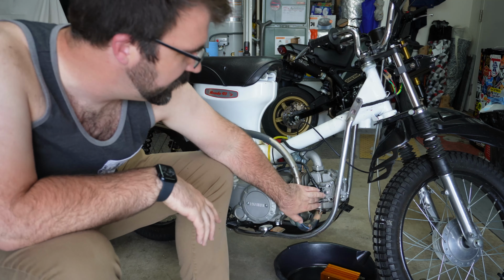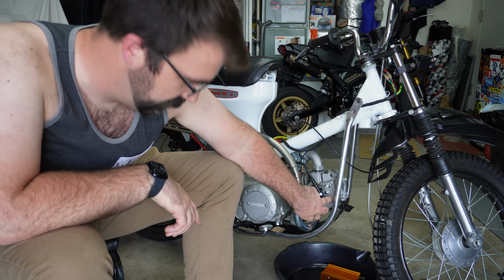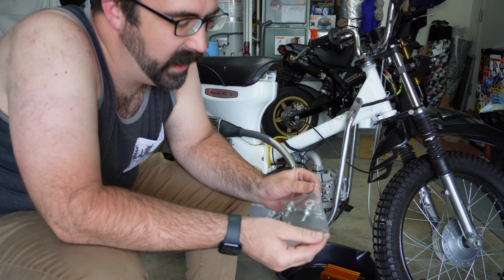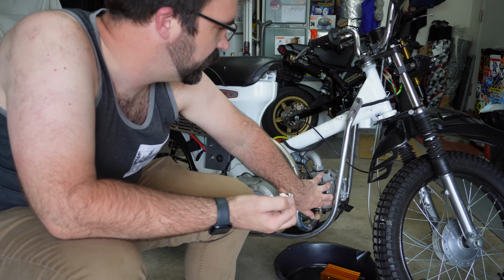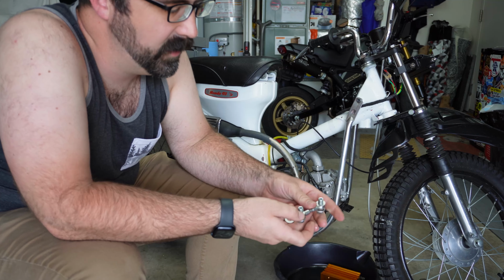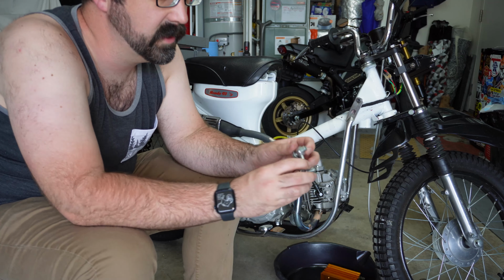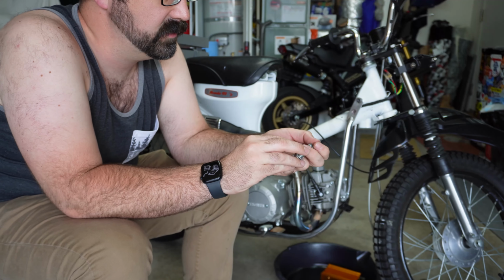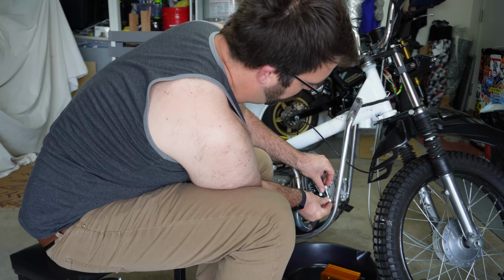One of the other nice things that we're dealing with now is it came with the oil cooler head plate already on there. A lot of the YX motors you can put aftermarket coolers on, but you end up having to buy this head plate and figure out how to plumb it in yourself, whereas this one came with that on there, and then it came with just this bypass hose pre-installed, and we're gonna reinstall that and hope that it doesn't leak everywhere.